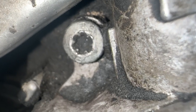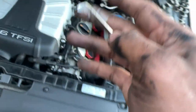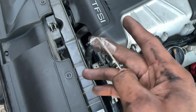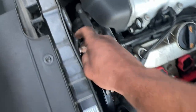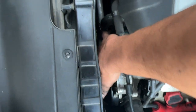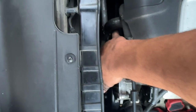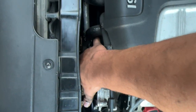So this is the second bolt — it is completely filled with oil and gunk. If you do not clean this out, you will end up stripping the bolt. I'm cleaning out the bottom and last one to pull out. I have an allen wrench taped to my finger and I'm just cleaning it out like that. Simply reach down, find where the screw is, clean out the head, and this will prevent you from stripping the bolt. This is a must — very necessary.